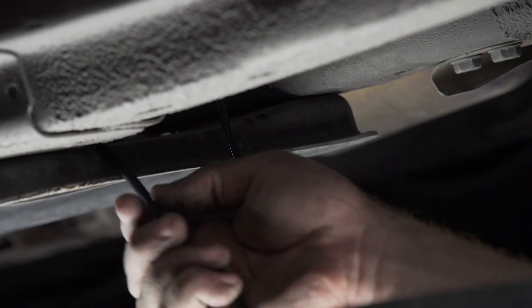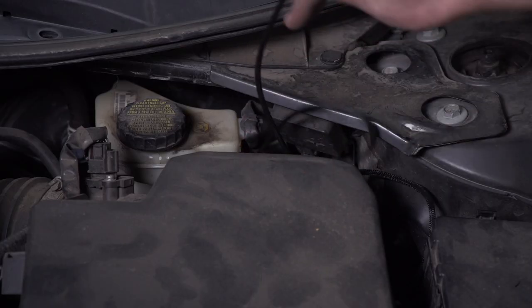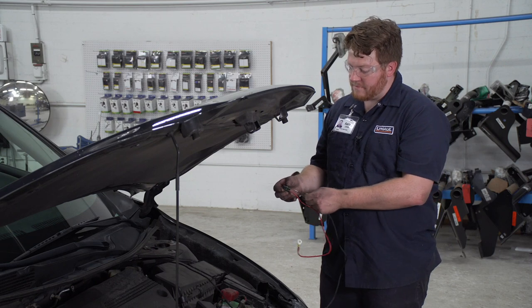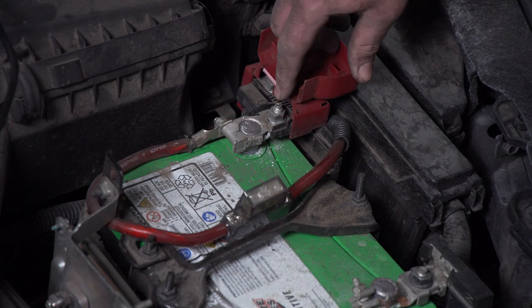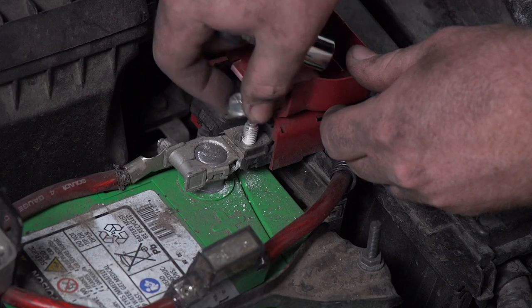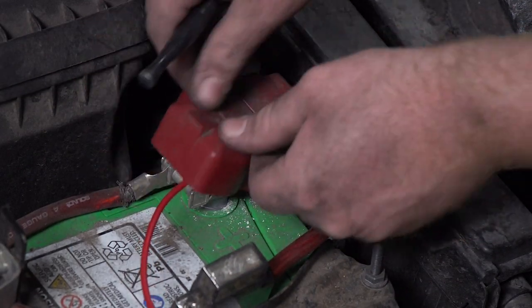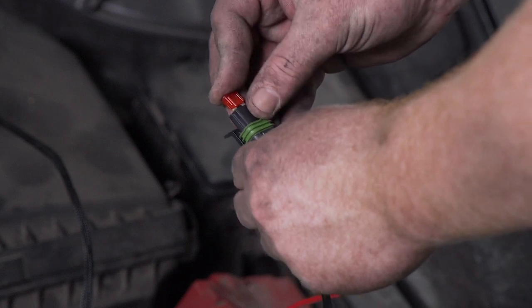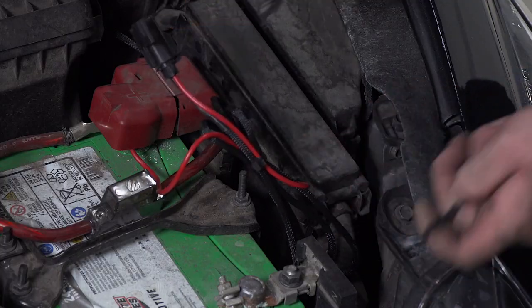Now that we've reached the bottom of our engine compartment, we're just going to push our wire up following these brake lines. In our engine compartment, our wiring is going to come up right behind our brake reservoir right here. Now we're going to connect our power wire to our fuse holder, and then connect our fuse holder to the positive terminal on our battery. We're going to remove this nut using a 12-millimeter socket. Now we're going to insert the provided 10-amp fuse into our fuse holder and put our cap on. We have some extra wire, so we're just going to tuck it in behind the battery and zip-tie it to clean it up.